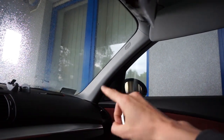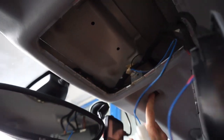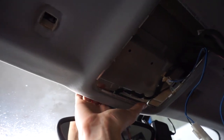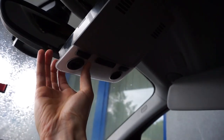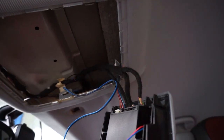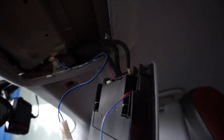Wiring the car was the hardest part, so I had to disassemble the A-pillar cover — there's a separate video about removing that. To remove the dome light, you unscrew the sun visor holders, and with those removed you can bend and stretch that trim piece, access the dome light, and push it out. The dome light uses two clips to fix it to the roof, so you press those and push it downward. Be careful because there's a lot of wiring up there — you don't want to pull it too hard or disconnect anything.